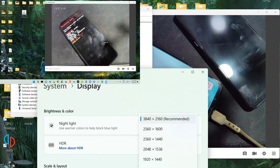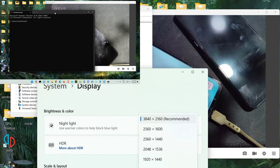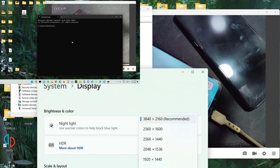This is the patched boot image with Magisk. This is slot A. Open your command prompt. We're going to flash the Magisk patch. fastboot flash boot_a. This is the command we're going to flash. This is the partition boot_a and the file. This is the file we already patched just now with Magisk.